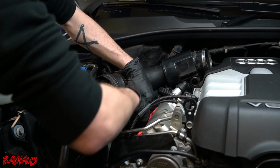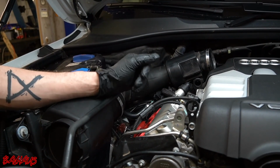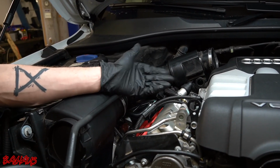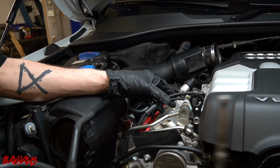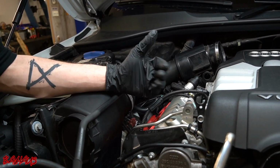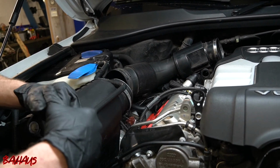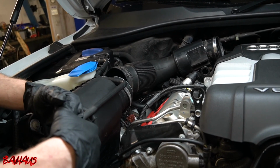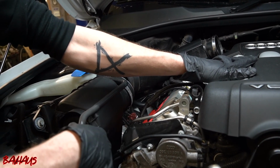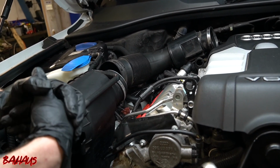We're going to be taking that supercharger off again afterwards, regardless, obviously, if there's an issue. We're going to have to because of the fuel injector. But aside from that, we will be walnut blasting it. We're going to be doing a carbon clean. We're going to be changing the water pump and thermostat. We're also going to be changing the crankcase breather box and a few other things while we're in there. Oh, the oil for the supercharger, and obviously a drain and fill of new coolant for this 3-liter V6 TFSI.